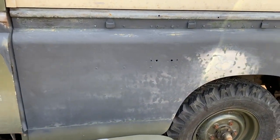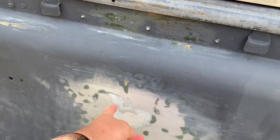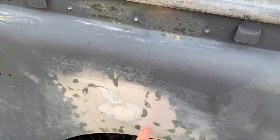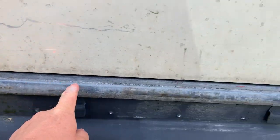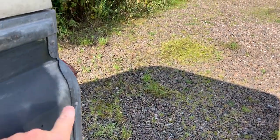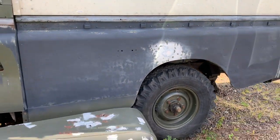What I want to show you now is what I've actually started. I've started to give the sides a bit of etch primer — you can see where I've given it a light coat. There was a really bad hole here so I've been giving it filler and sanding that back, and it's back down to bare aluminium here. So I'm going to give that another quick coat of etch primer. I need to get all of the galvanised parts here taped off so I can spray the etch primer right up to the edge, because the paint needs etch primer to stick.